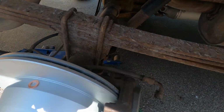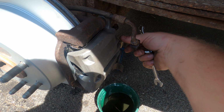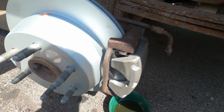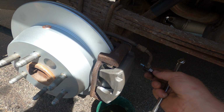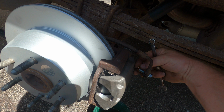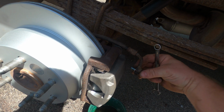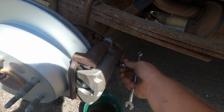Okay, so that side screwed on at that 9/16 to get that fitting together, and then like I said, just pull this plug now so that you won't get crap in it. Single copper washer on this side, and a single copper washer on the other side, and it's an 11mm banjo bolt. It goes on here. Yeah.